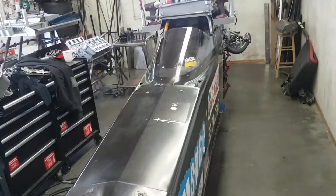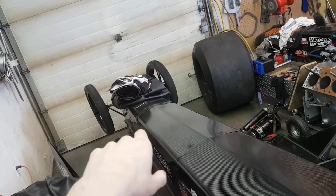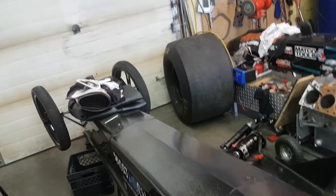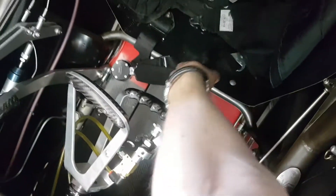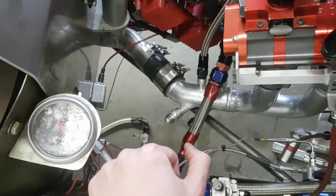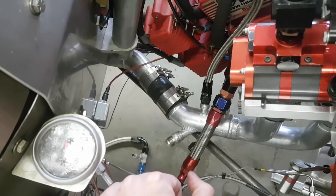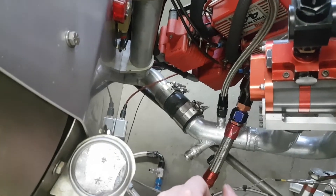Let's take a look at the car. Here we've got our top fuel dragster. Now you can see these are long vehicles. The fuel tank is up at the front underneath a bunch of stuff there. We have a fuel line that runs through the body, underneath the driver's seat. You can see that little box compartment right here. It'll go across along the side, and you can see here's the line. We've got double hose clamps on each side and our rubber joints. The reason for the rubber joints is that it helps mitigate any sort of vibration and flexing, preventing any sort of stress crack or fatigue crack from forming.